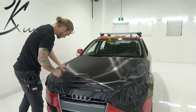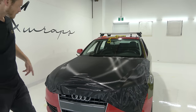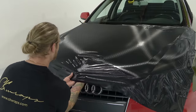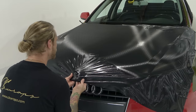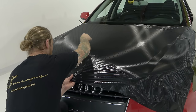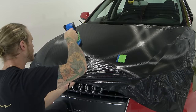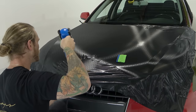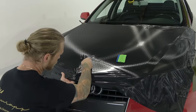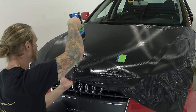If you do this over a small area, you're going to distort the carbon fiber in a way that looks really bad. Expanding the film outwards as we come down and around this edge. Now I'm going to take my hands right here since the film is still warm — put my hands over top and finish that up. Now check out the middle area — it's really good right now because we have our lines running across. All we technically have to do is pull these wrinkles in this direction. I'm going to add a little bit of heat just to soften it — not stretch the film. If I stretch it at this point, we're almost 100% going to distort the pattern.